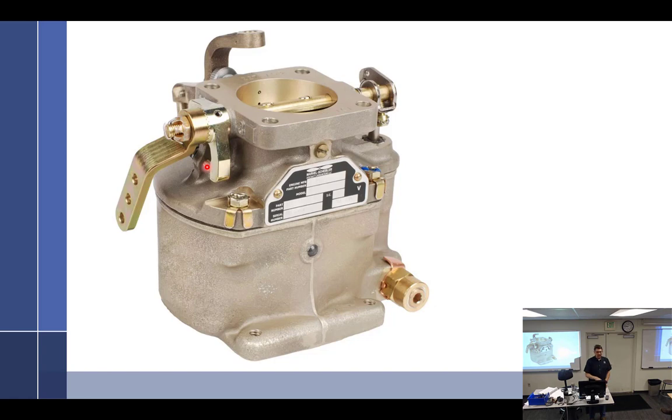When you're on our ground power unit doing this, you cannot do it that way because there's nothing connected - there's no throttle going to the cockpit. You're actually going to have your hand on this piece right here moving it, and the only way to hold it rock-solid steady at an idle is to adjust the screw to where you want it. So you adjust the screw first, then start messing with the mixture, then pull the mixture, and then you may have to come back and adjust the throttle a little - but that's fine because you're standing right there.